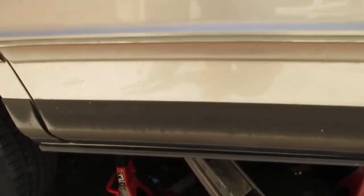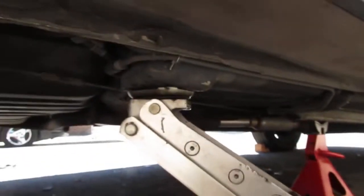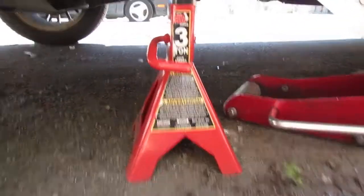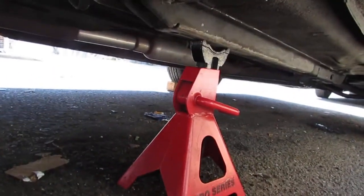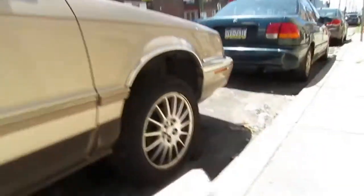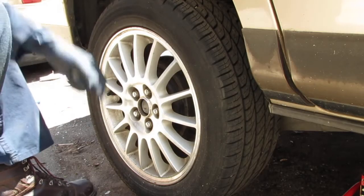This is a tricky one for me to figure out safe spots to jack and place my jack stands. I want to show you what I did — jack stand here, the second one right there. I always like to have three support points underneath the car to protect myself. Then we chocked the wheels. Let's get this wheel off — these are 19mm bolts.